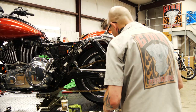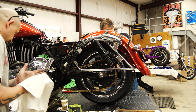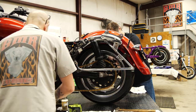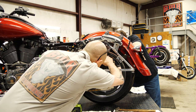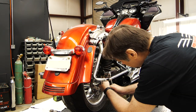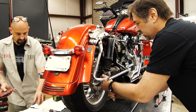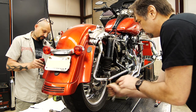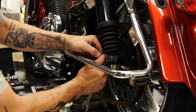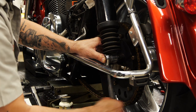James on the other side is starting to assemble. We're told to torque it to 95 to 105 foot-pounds. Insert the cotter pin — if the pin doesn't line up perfectly, slightly rotate it until it does. One thing to note: this sits pretty tight to the shock mount, so bikes with an accessory lowering kit that extends back — this kit will not work on those. The kit is designed to work on a relatively stock motorcycle.